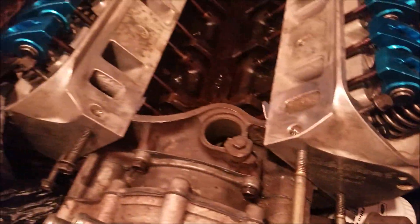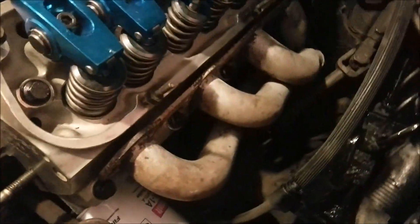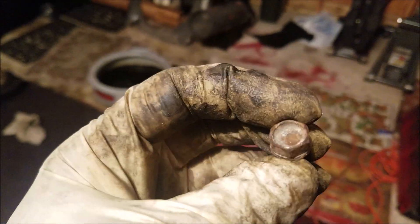So we've got all the push rods put in. The rockers are not torqued down properly or aligned — basically just sitting on there. Went and cleaned up a few areas inside the engine bay that were just a little bit crusty. I removed the rat nest and vacuumed up a lot of the dust and the crud. Tomorrow, since we have space, we're actually going to try and combat some of this rust. The last thing we're going to do is attach these headers and put the header gaskets on. I've picked up these Allen key bolts — those will take an Allen key, but they should be a lot easier to take in and out, because the stock bolts sit right up against the headers and they're just really a pain to get in and out. Hopefully the Allen key bolts will be a little bit better.